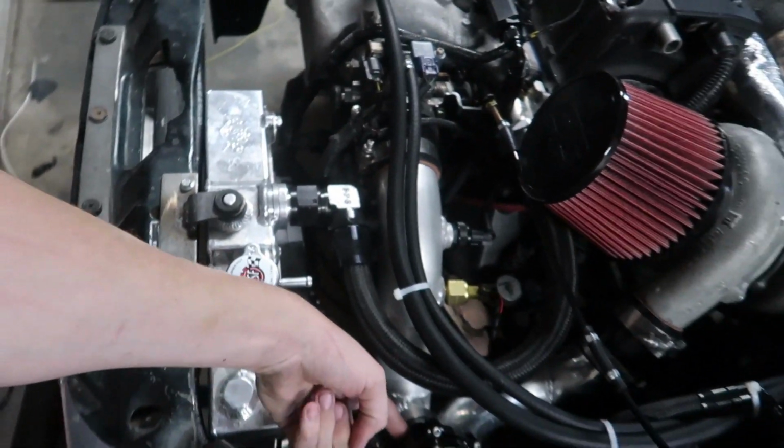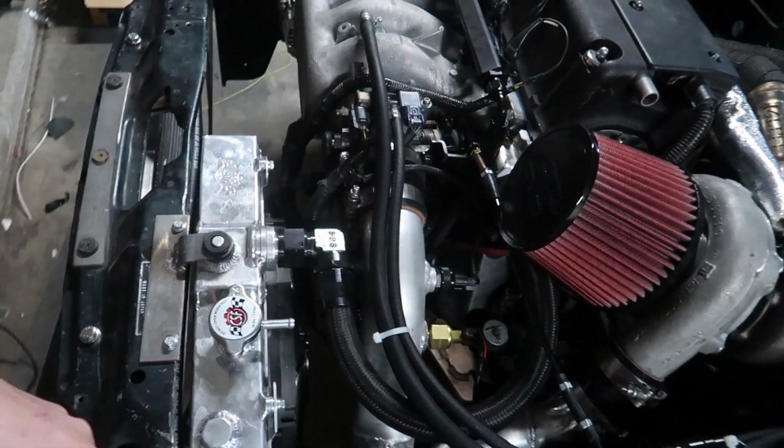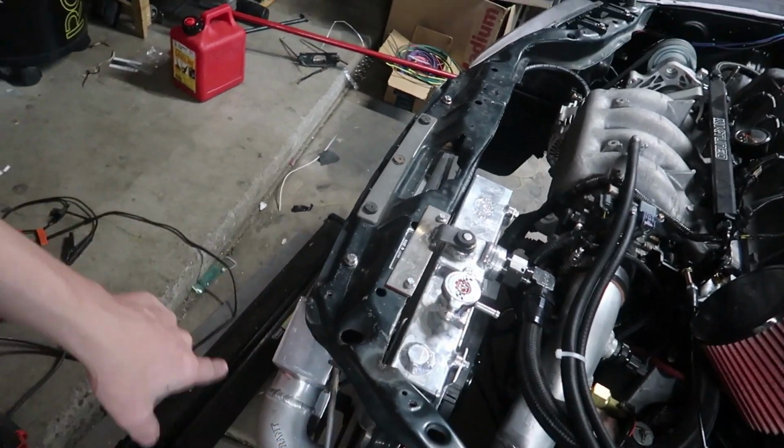All right, so today's Wednesday. I think it's been since the weekend since I've updated the video, but I have been working, so let's play catch up. Number one, I had some issues with our wastegate not wanting to open. I thought maybe some of the piping had a factor in the vacuum. Turns out it didn't. Turns out the major factor was the spring.